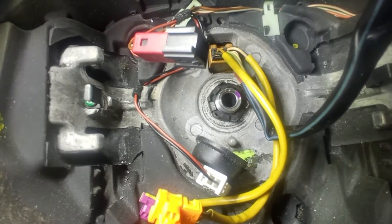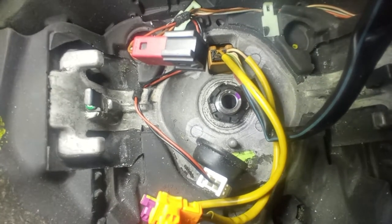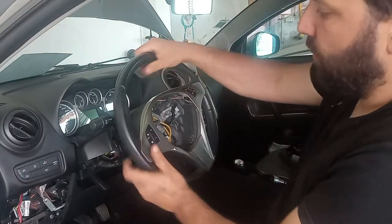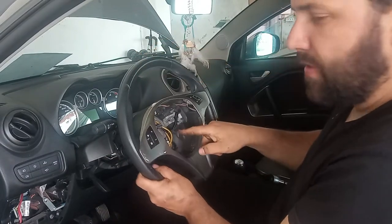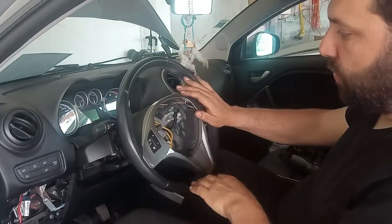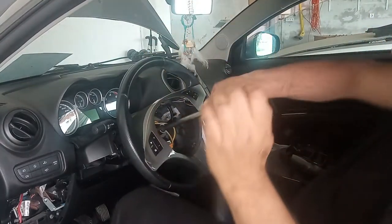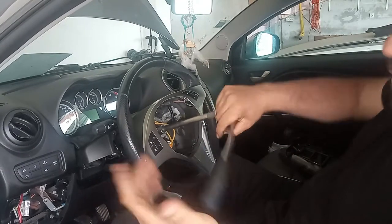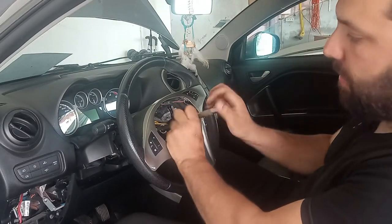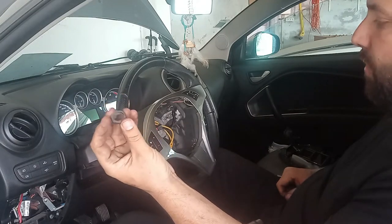Like I showed on the 156 video — how to remove the steering wheel is also linked in the description — in order not to put too much force on the lock, do it with your knees. All the way down, turn the steering wheel a little to the right and apply force with your knees, or have someone secure the steering wheel. The idea is not to put too much force on the lock. The nut is special and comes out all in one unit.